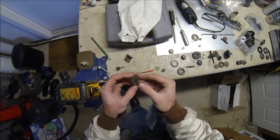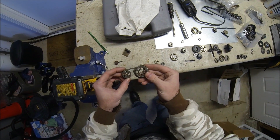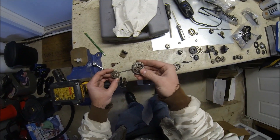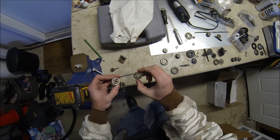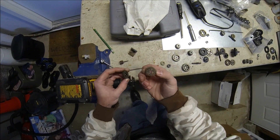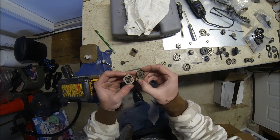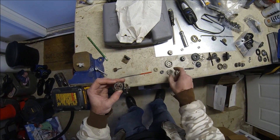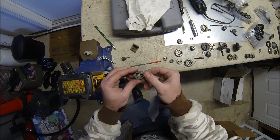From the original 3-speed — remember, it goes with the 38-tooth third gear. The 3-speed now comes with 26/36, and that won't work. This is the Octane's 24-tooth — while it is a little thicker, notice it doesn't have a slot for the pin, because it's a gear that just sits in the middle and the pin slides through. So it won't work.